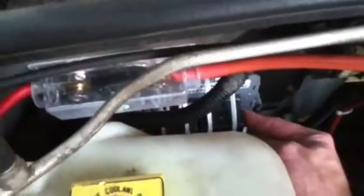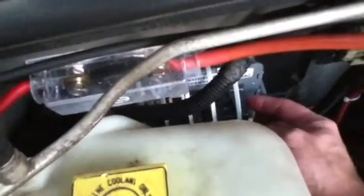So, take the pins, clean them, bend them at a slight angle, like, I don't know, 5 degrees, 10 degrees maximum. And I will say this now, I don't take any blame for you guys busting your pins, because I didn't bust mine. So you got to be careful doing it. If you bust yours, don't come pointing fingers at me, because I'm telling you right now. Then put dielectric grease on the plugs, plug them back in.